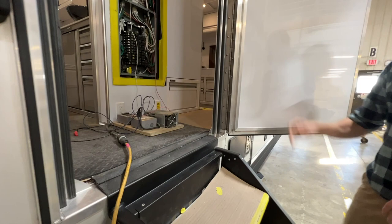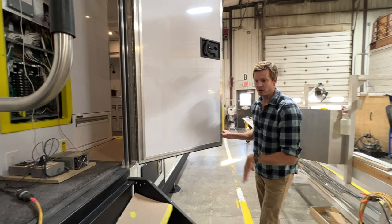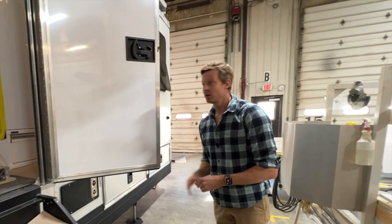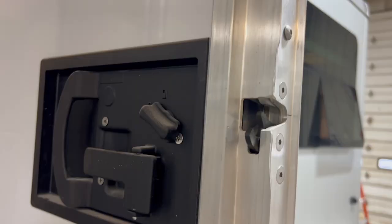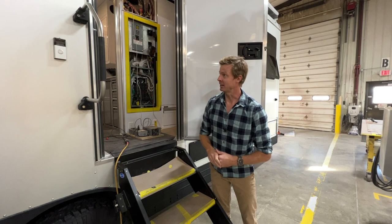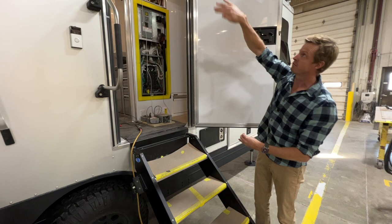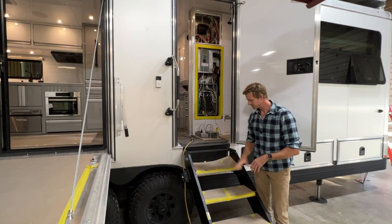All of this is built out of 100% aluminum — powder-coated on the inside, anodized aluminum on the outside. This is a 2-inch thick door with architecturally designed details to keep out water. This is a heavy door, so for those concerned about security, this door is not bulletproof but darn close to it. The latch is an automotive-grade post-style latch designed for security, so you don't have any lockpicks or folks getting into the unit. The step mechanism folds up and resides just inside the door, and the door now has squared-off channels to match all the other hatches and the patio gate deck.